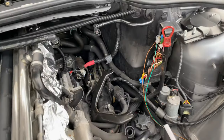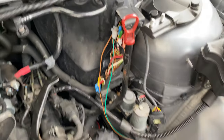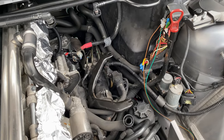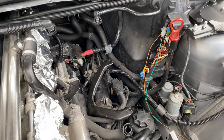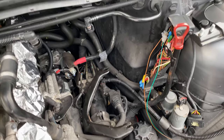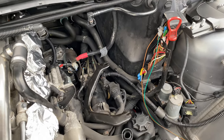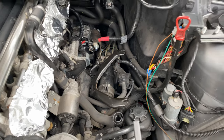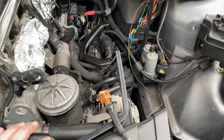So for those of you that watched the video, obviously we wired back in the sensor. Unfortunately, for those that were keen spotters on there, we're about 18 something degrees out on the temperature sensor, on the air inlet temperature sensor. It doesn't mean it's broken. What's happened is I've gone back to the original CSL intake sensor, and where it was set up for the GSR airbox, it used a different brand of air inlet temperature sensor, so the scaling's different.